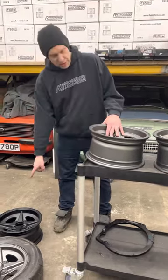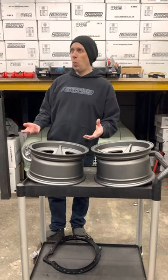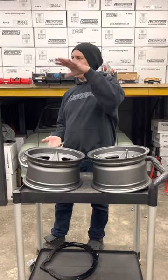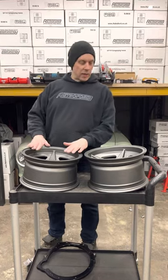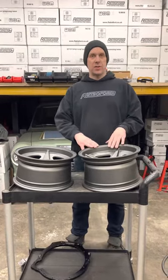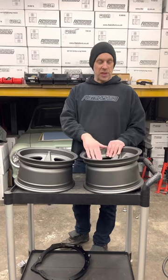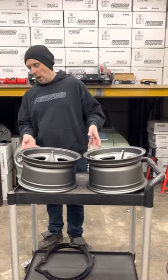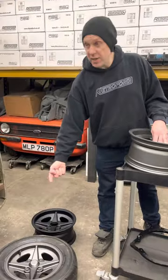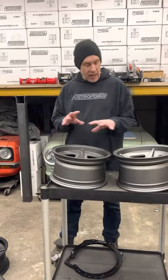So five and a half, that one's a six, and this is a 6.5. A lot of companies don't manufacture a 6.5, and I'm not sure why, because on a Mk1 Mk2 Cortina a seven's a bit too big and a six potentially you could go a little bit wider. So we're hoping these are going to go on a Cortina fine. And then we've got the sevens, which potentially your bubble-arched and forest-arched Escorts could potentially run a seven. In the future we might do a seven and a half, but these are all now in production. They'll come with a centre cap — we do a flat cap and we do that raised cap to miss the front dust cover.